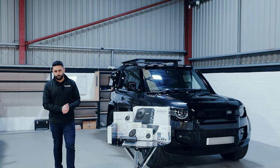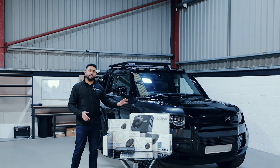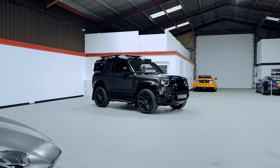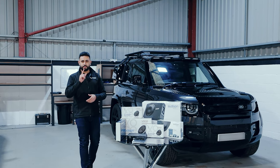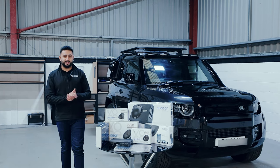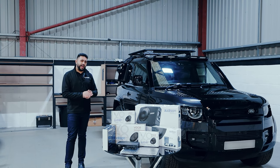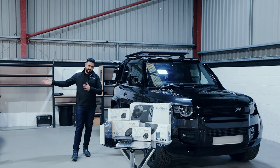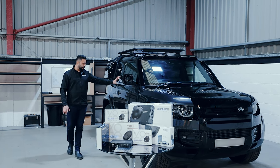You have a lot to look forward to, but let's go through firstly what is actually in the vehicle currently and what is the vehicle. This is a Defender 90, a commercial vehicle. In terms of sound, that basically means it has no rear speakers — however, there are actually grills for the rear speakers, it's just that there's nothing there. This has the Meridian sound system, so there is an amplifier in here and signal going from the head unit into the amplifier, out to the speakers — similar to what we're going to be doing, but with decent gear.